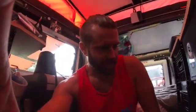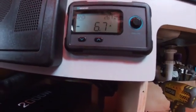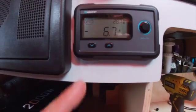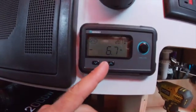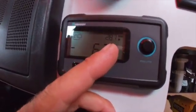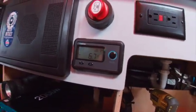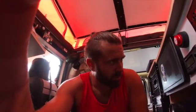Alright, we are connected, hooked up, inverter's on. Cycled the AC on — so the AC unit fan only is on right now. We are actually pulling — you can see right here, it might be hard to see on the screen — it is 6.7 amps. You can see the negative on this side; that means it's pulling amperage out. When it's charging, the negative would be gone because it's a positive number. There are also hours remaining — if we were running the fan 100%, looks like we can go roughly 30 hours with that on at all times.